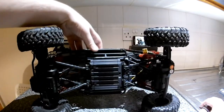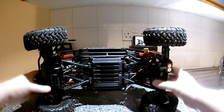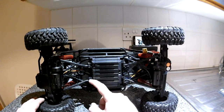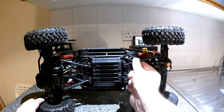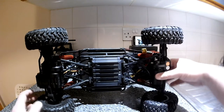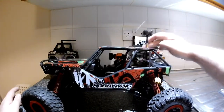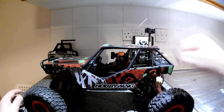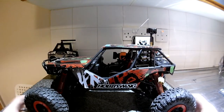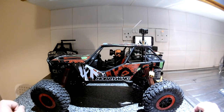The only other thing I want to do is stop all this rattle - I need some O-rings put in between these link bars to stop all that play. I'll probably also change the shocks because one of them locks and then goes down eventually, so: change the shocks, O-rings on the link bars, and it should be good to go.